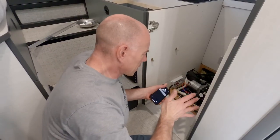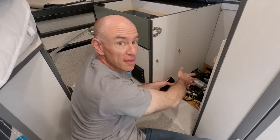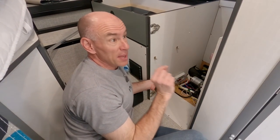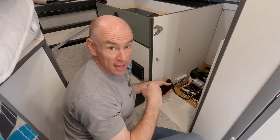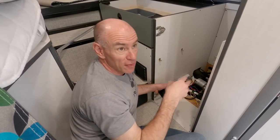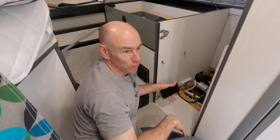Now I need to fill up the RV with water and start the sanitizing process, and during that whole process I'm going to be checking everything I just worked on for leaks. Sanitizing a tank is like half a day worth of filling and draining the RV. But during that sanitizing I'll be able to test the one-hour auto shutoff feature — I'll turn on the pump, run it through all the faucets, and then leave the pump on for an hour with the faucets closed. That'll test both the pressure of the fittings I just put on and the long-run shutoff.